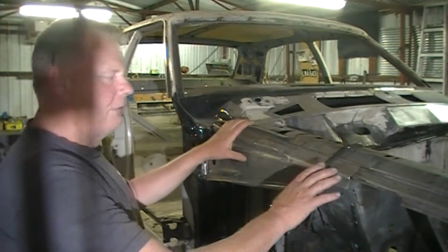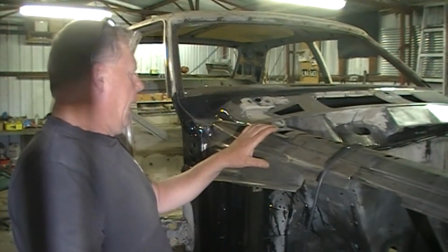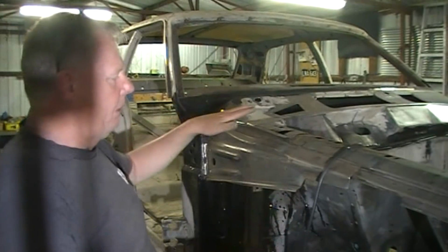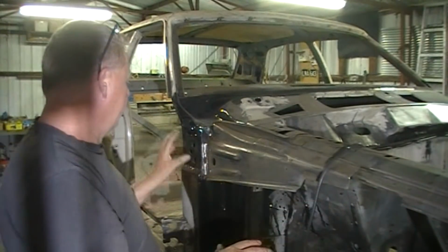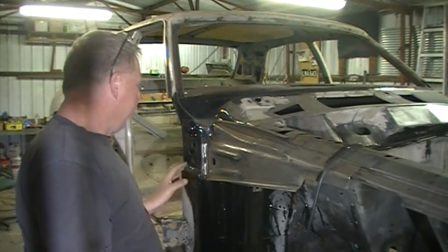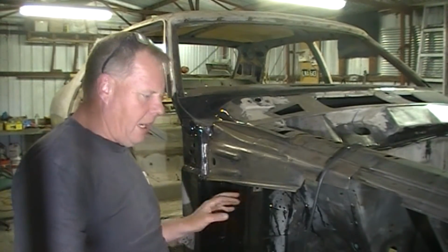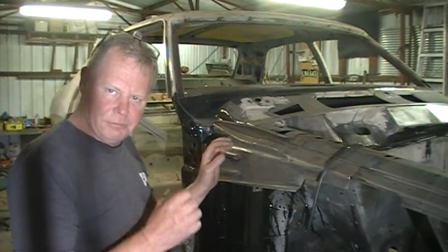These are all on. I've started to sand back all of the steel and going to sand the whole plenum, all of these rails. Going to sand this POR 15 down a little, basically keyed in, so when I spray the 2-pack primer over it, it'll stick to it.